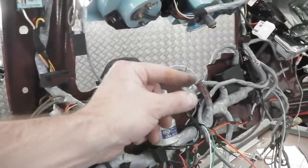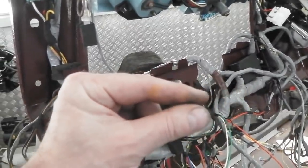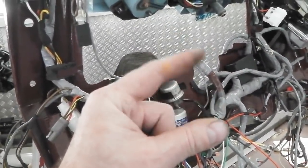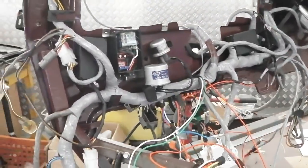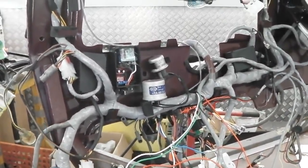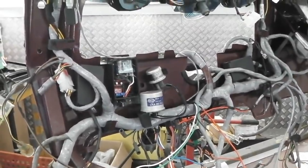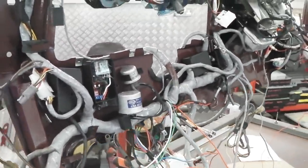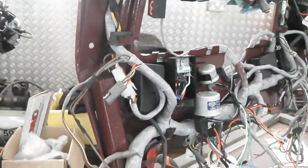They use the metal as the actual electrical contact. So as it gets hot, it curls up because of the different expansion properties of the two pieces of metal. That's just physics. It bends away and breaks the contact, cools down, makes the contact. So that's your pinging noise inside a flasher, that's all it is. The metal's built so that it's under physical tension too, so that when it bends, it snaps into a shape which they've formed. As it cools down, it goes out of that shape, and that creates a snap action, a pinging action, which echoes inside the aluminium can, and that creates the pinging sound that you hear.